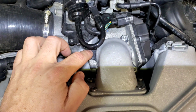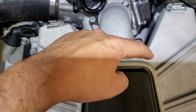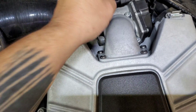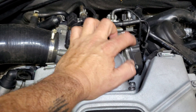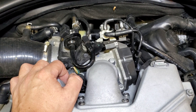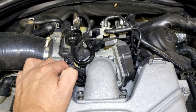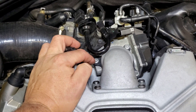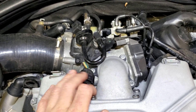It's super easy to remove — just these three screws right here, and then these four screws here from the snorkel; you've got to remove all four of those. Once you have that out, this will remove off. Be careful not to drop this plastic plate here, and then you can pull this whole thing out after you disconnect this plug. It takes five minutes to get out. Sometimes the gears inside can break, wear down, and stop working correctly, or it can just have an electrical failure. You don't need too many tools — you're going to need a T30, and you might need a T20 if you're going to take this stuff apart.